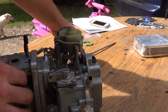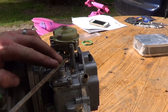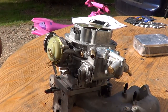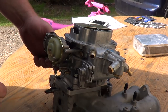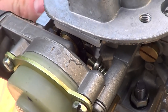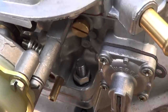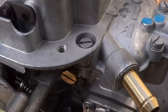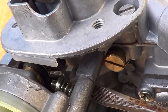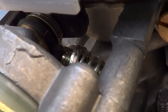This is something that's really confusing a lot of times. This right here is your cold idle start — this adjusts your speed when it's cold and you hit the gas the first time. You'll see it: you hit it the first time when it's cold, this cam comes down. When you give it gas cold, it hits that cam and gives you a higher idle when it's cold — when the choke is closed. You can adjust that just like a regular idle screw. Then when it starts warming up, that cam starts turning this way and gets over that lobe right there.